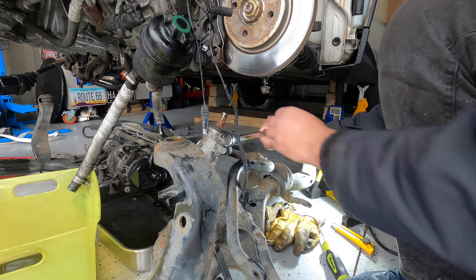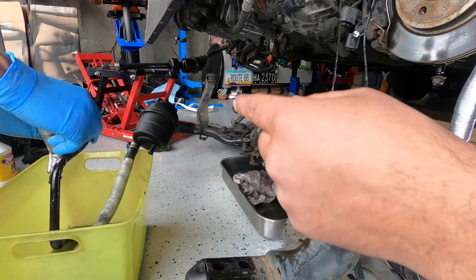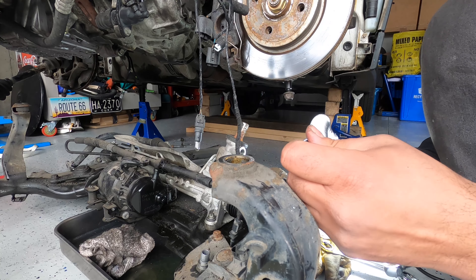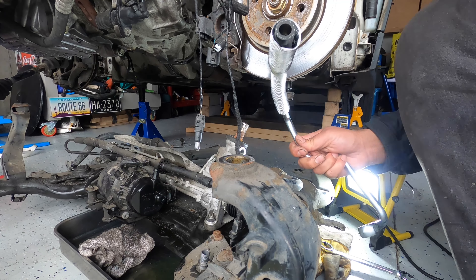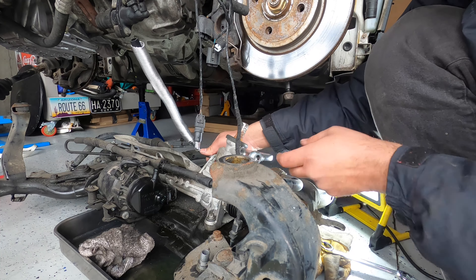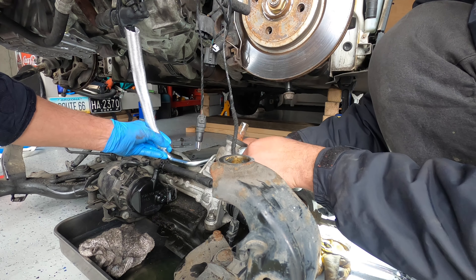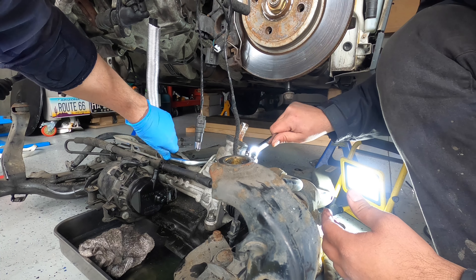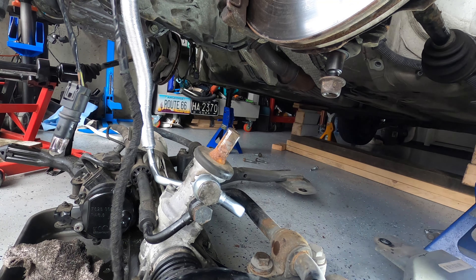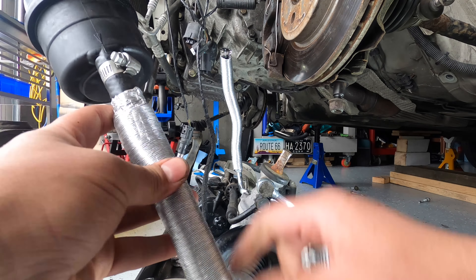That's a 22mm spanner. Now the old hoses are off and we're keeping one on just to remember which one goes where. First we're going to do the high-pressure one — this is a new part that I bought. Take off all these bits, put on new washers and hose clamps. Put in the banjo bolt and crush washer — it needs two crush washers, one on each side. That's where it goes right there. Now we can try putting the hose clamp on top. The return line is already on there — a new one.